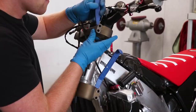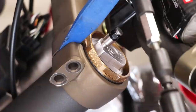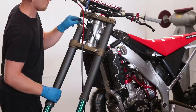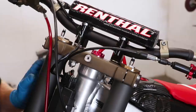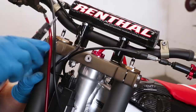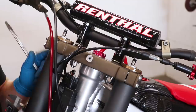I'm going to pop those forks on first. I'll start with a fork height about one or two millimeters above the triple clamp. Once you've got your fork height identical on either side, you can go ahead and measure it with a set of calipers. Measuring: 7.77, 8.30 — this one's gonna have to come down a little bit. That is 7.8, so close enough.